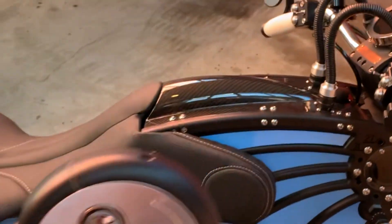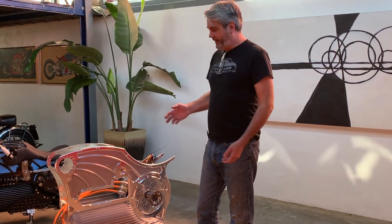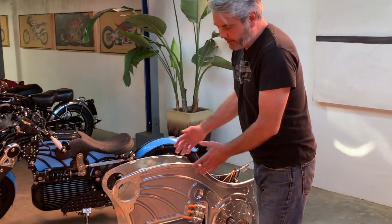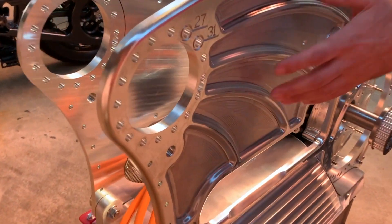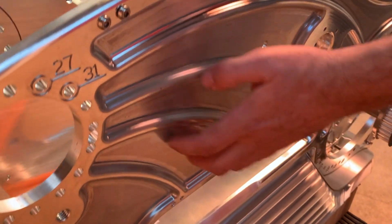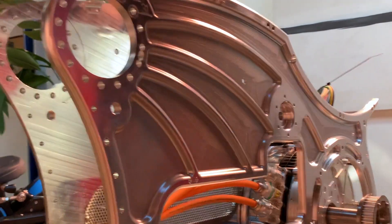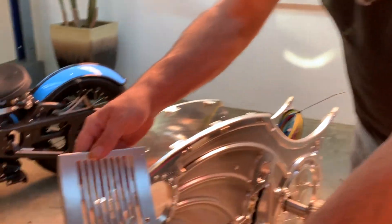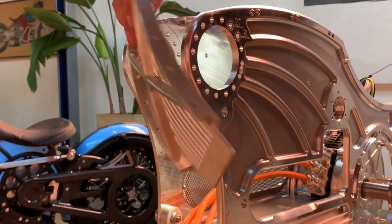In the rear of the motorcycle, more or less the same part is used for our belt tensioner adjustment. Let's have a look at our chassis. What we have is a chassis that consists primarily of two structural machined 6000 series aluminum plates. You'll notice all these ribs in here — these are to lighten it and add strength. We also have the option of putting a color, texture, and material inside these pockets. In the front, these two plates are held together with the steering neck and this great-looking grill, which is an air intake but also a structural part.